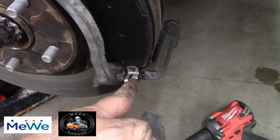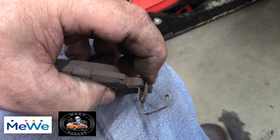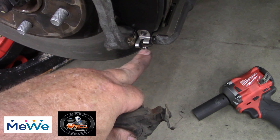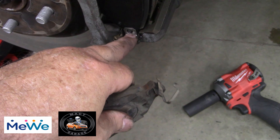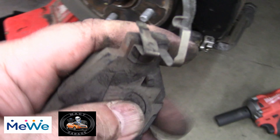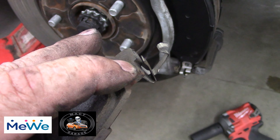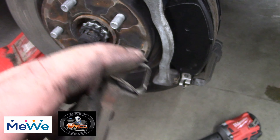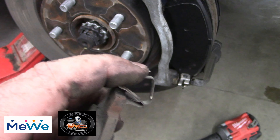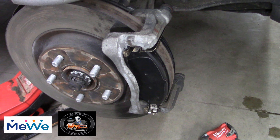Got the clip in here — this little clip has to be bent in and slides against the end of the tab, it goes inside against the plates. This one goes on the outside, so it's like an outside spring. Once you get it bent up enough you can slide it in and it fits nice and snug. You have to manipulate it — push it in and it'll slide because the ear is right there. Pretty simple once you figure it out. Got them all greased up, going to tighten up the bolts and compress the pistons in.